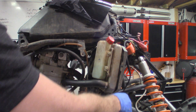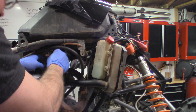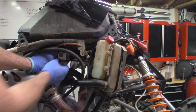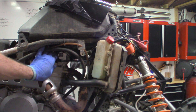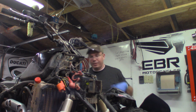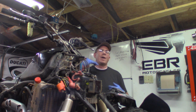We'll run the coil wire the back way it was run and put the coil wire on the spark plug. Make sure you've got enough room so it's not too tight, because it'll move a little bit as you're riding. With the new spark plug and coil, let's see if she starts up.